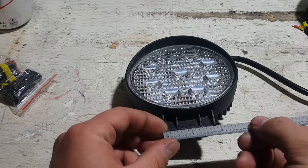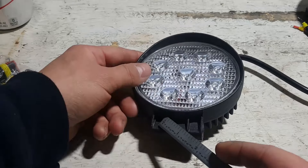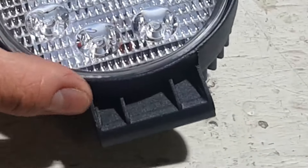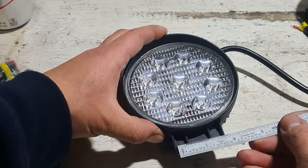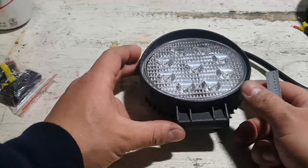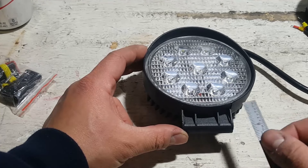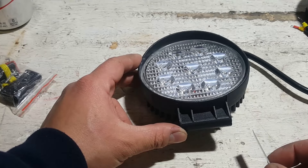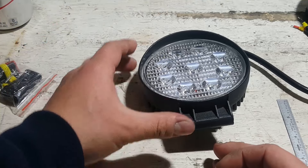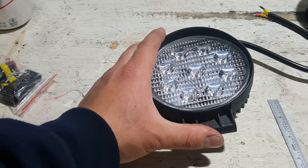So I'm going to make our light just shy of one and five-eighths inches. On our light here, if we measure these little marks, literally the distance between here and here is exactly where we need it, so I don't even need to mark these — I'm going to shave it down right to those marks. If you have a different variant of the light, you may have to mark it off with a pen or paint pen. But definitely mark it off, otherwise you'd kind of be guessing. So I'm just going to take a flapper sander, kind of like a grinder, set it up in our vise, and this should shave down very easily. I'll be a little bit on the conservative side the first time.